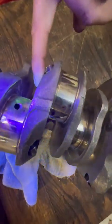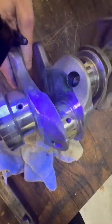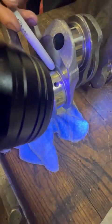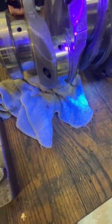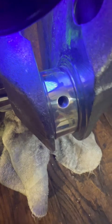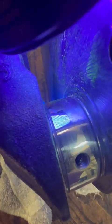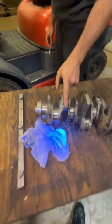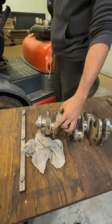It even started cracking on the backside just slightly. Just started in these corners and it's kind of in the weakest part of the crankshaft, so I'm not really surprised. They're a little tough to see on this side — they're not as pronounced. But you can see that's where the overlap is happening between these two different rod journals.